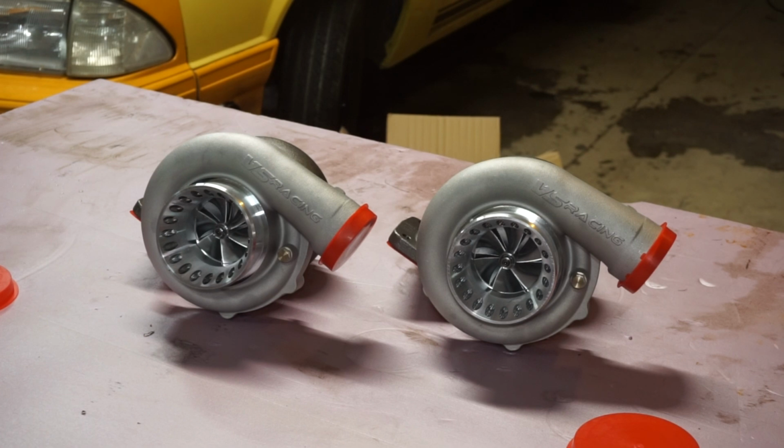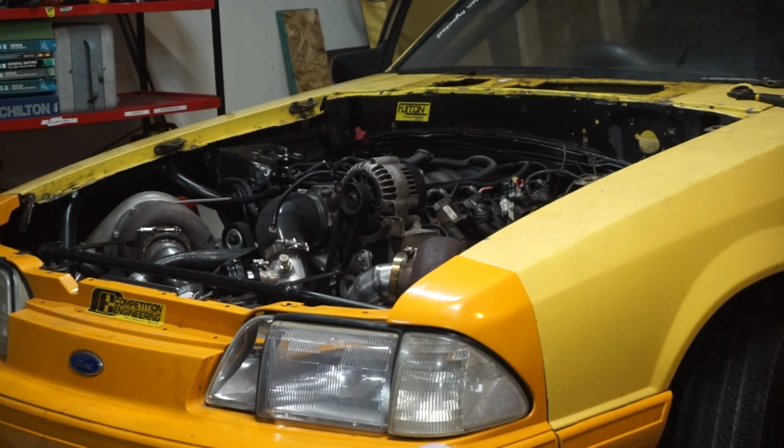And then we can see the differences between the cheap ones and the upgraded ones with the proper exhaust housing, and get them to spool quicker. So that car probably would do really well with like a single GT45 maybe, because it would spool quicker. It's not like a terrible turbo for $160, but there's just definitely better options for cheap also. But that was basically free when I bought the car, because I bought the car with twin turbos. They were mismatched, but I traded one for the other GT45 because I had one on the shelf. So that's why I did that one. Cheap, cheap, cheap. That's what happened.